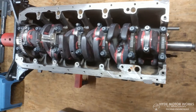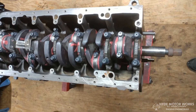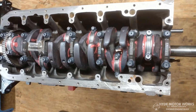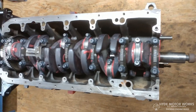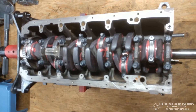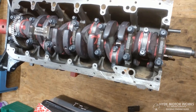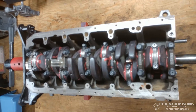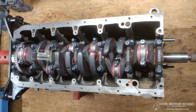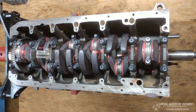Since I want to push it even further, I decided to build something that can handle it. DNF Performance out of Berlin, New Jersey did all the machine work and also sized the bearings so I had the proper clearances — I believe it's like 21 to 23 on the rods and mains, which should be plenty. You don't want to run too tight of clearances because that can cause excessive friction and heat buildup, but you also don't want to run it too loose, especially if you don't have a really high-volume oil pump.